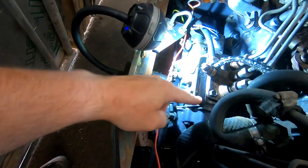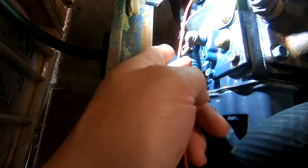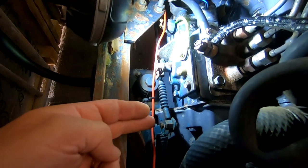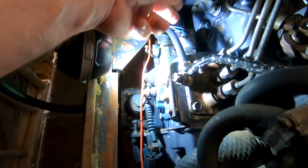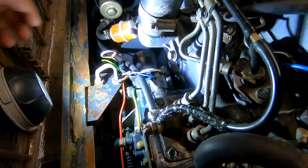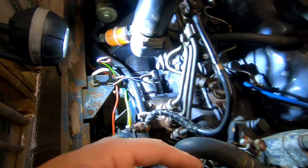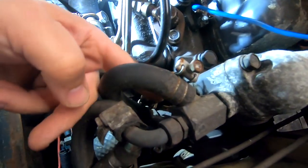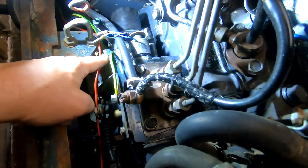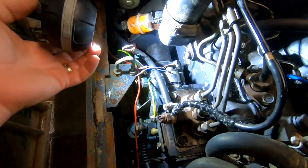On the old fuel pump, there is a mechanical shutdown, so I could put something on that, a spring or a cable, or I don't know if there's a way of doing it between these two instead of just using the electronic. By looking at the wiring diagram and my very limited knowledge of wiring, that one is like an auto shutdown if the temperature goes too high from the sensor in there, or the oil pressure goes too low from that one. I will have to repair that, but I think that's what that one's for. It's for emergency shutdown. But that's not what we're doing today. Waffling already, three minutes, flipping heck.